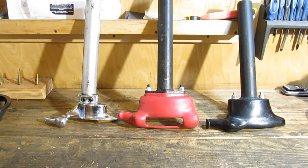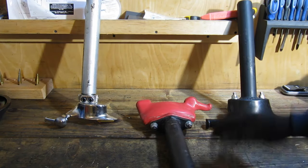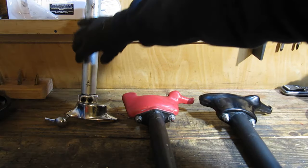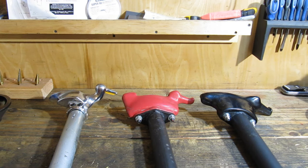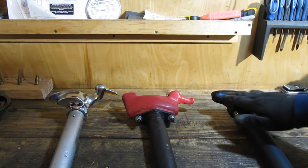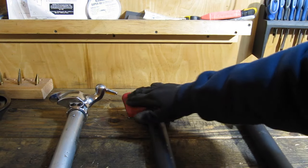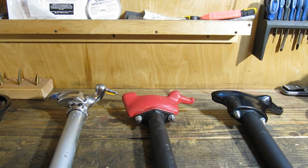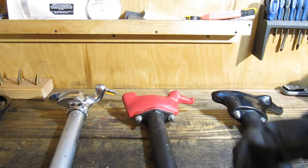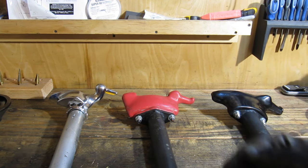Some differences I've noticed: the red duck bill tool has double bumps on it — there's a bump in the back — while both of the other tools do not have that. I think that could be good or bad. On the good side, the tire when mounting might slip over the black duck bill a little bit easier without that bump. On the positive side for having the bump, it seems like it keeps the tire from riding on the rim, which can avoid abrasion on the steel rims to the inside of the tire when mounting.